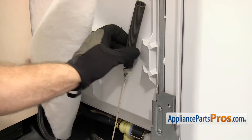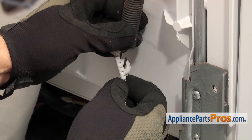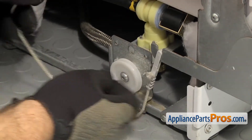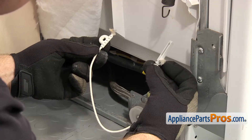In order to get it off, we're just going to grab the spring and pull down on it a little bit. We can take the door cable assembly off the spring. Once you have it unhooked from the spring, we can take it out from underneath the roller and then we can unhook it from the hinge. Once you have it off, you can pull it off the dishwasher.